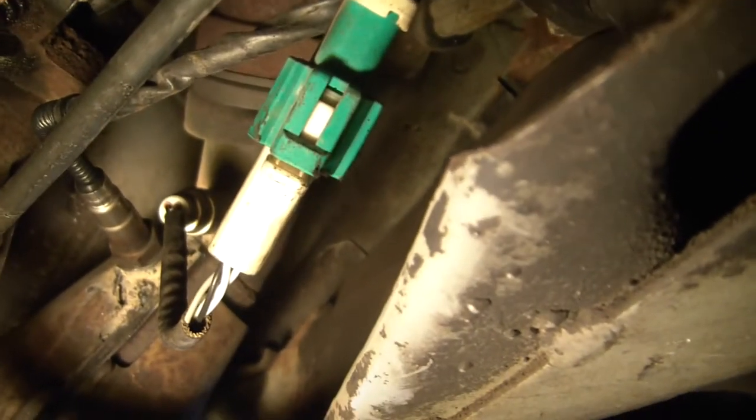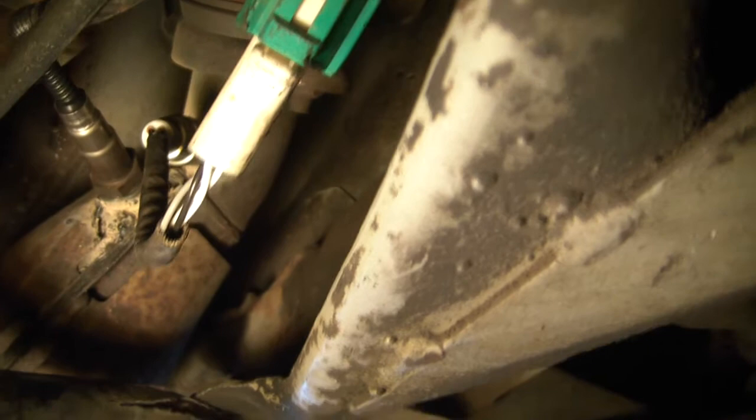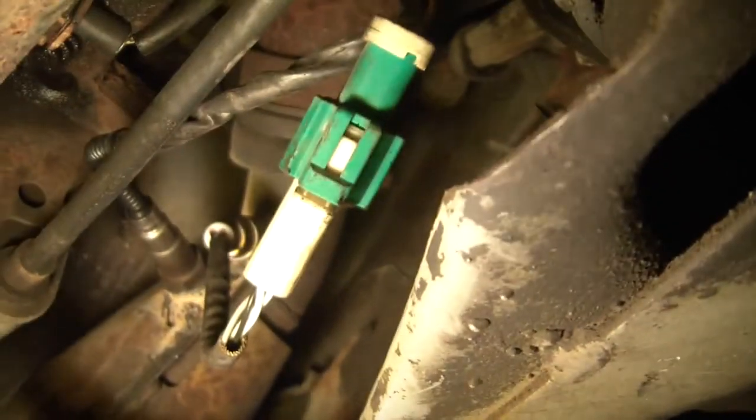So I'm going to have to pull that O2 out. I'm going to take my torch and see if I can flow that where I welded it, to get it to flow a little bit nicer than that — on top especially. You can tell it looks sealed on the bottom. It's the top where I was welding blind.